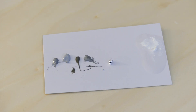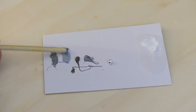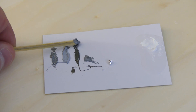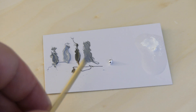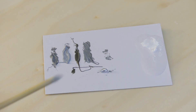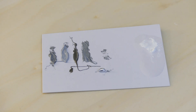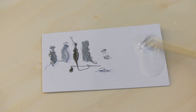Let's try smearing them a little and see how they act — whether they're hard or smooth. The Noctua NTH1 is smooth, NTH2 even smoother. The Arctic Silver 5 is smooth but a little bit hard — a bit stringy. And the Cooler Master is really smooth. Then we have the Thermal Grizzly — the liquid metal won't spread out on its own; you have to use the cotton swabs that come with it. Remember not to use an aluminium heatsink, because the gallium will eat through it. Smooth it out over the processor so you don't get any pools, because it will seep out and short things out.